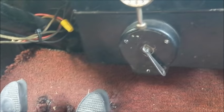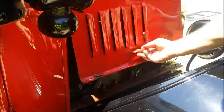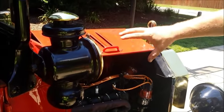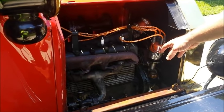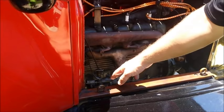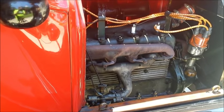You'll see how it goes in a second. This is the engine - these are spring-loaded, you pull them up and twist them and the whole thing comes up. This is just set on top; the whole thing will come off if you need it. Right engine has four spark plugs on the top. This is the distributor - it's a Volkswagen distributor that grandpa replaced. This is your carburetor. It has a single gas line that goes to the gas tank under the seat, and it's gravity driven - there's no fuel pump.